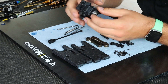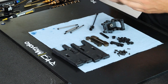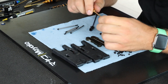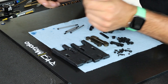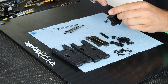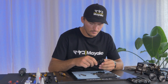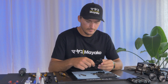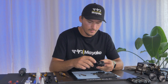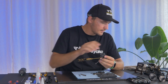So you push the pinion gear in like this from the back side of the gearbox. Now we're going to tighten the drive shaft here — the universal center drive shaft. We take this grub screw again with the flat part to lock the pinion gear in place. I tighten it just down a little bit to check that I have this little bit of play, same as I mentioned when assembling the front end. Just a little bit of play this way will make it spin completely free, and now it does — so I can go ahead and crank it down fully.